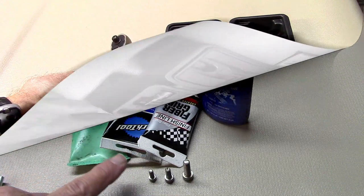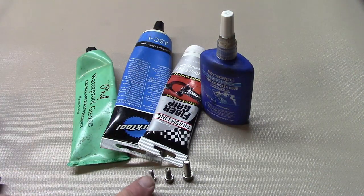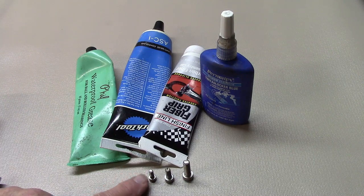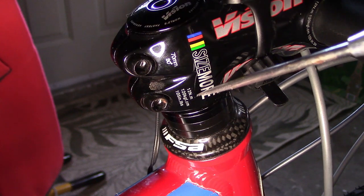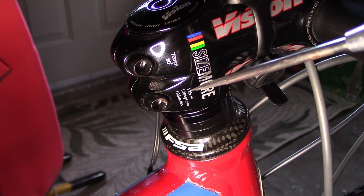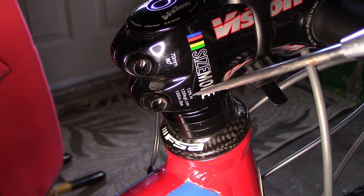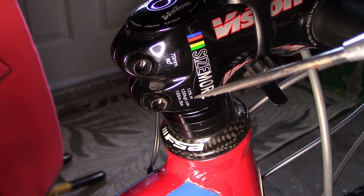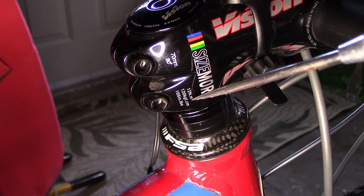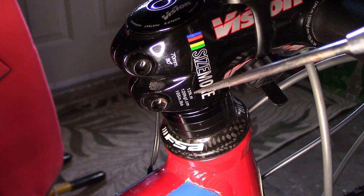Make sure you use the proper preparation on the bolts being tightened — see our reference in the upper right hand corner of the screen. Often the parts on the bike will be marked with the torque required. If it shows only the maximum, I use about 20% less. If there is a range, I use the mid-range. This particular stem is marked 12 Newton meters, so I'll use a torque of approximately 10 Newton meters.